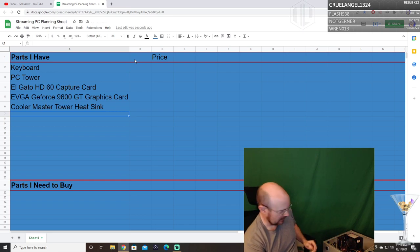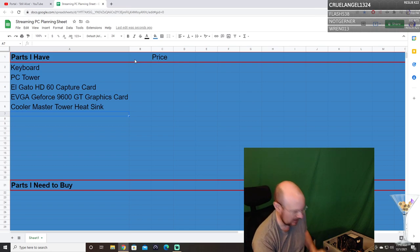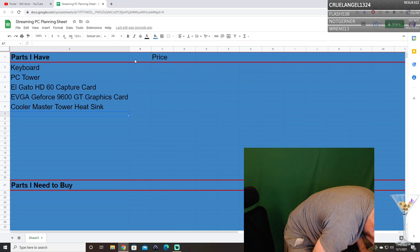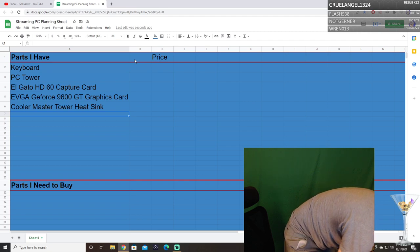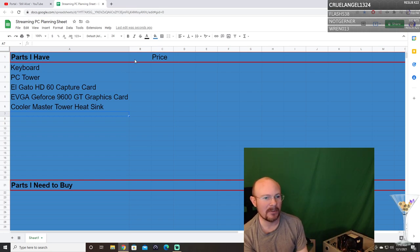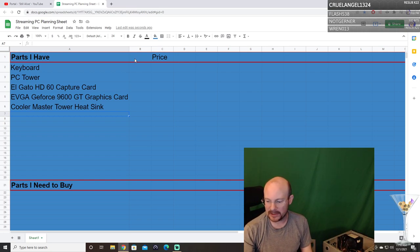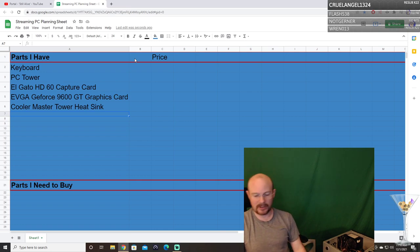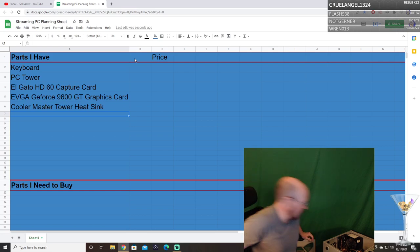So I have some hard drives and stuff. I'm going to take all these out because these are all old. Some might be usable, but I found that one of the things that really slows down my computer is using old, crappy, non-SSD hard drives. Oh wait, I can get my memory out first actually.